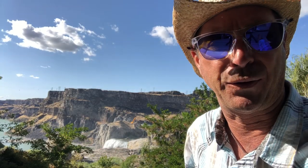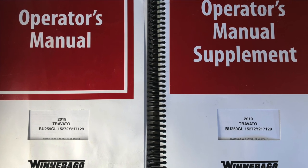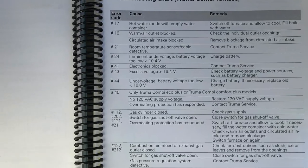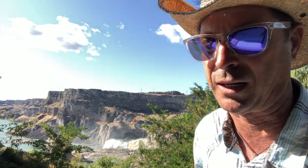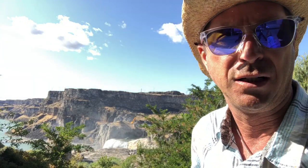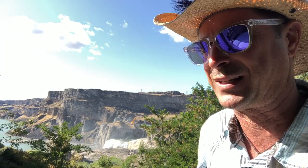Now that I'm awake, I pull out the manuals and I'm reading through them, and I can't figure out what the problem is. So it being now almost three o'clock in the morning, thankfully I have a Volta system — a Pure 3 Lithium Energy Pack — and I just switched the furnace mode from gas, which is propane, to electric. One and two elements firing, and got it going. Made sure it was going good, set to 70 degrees.